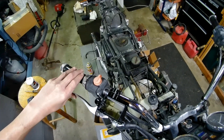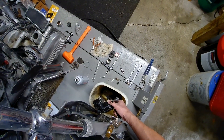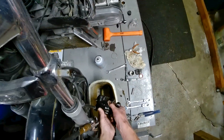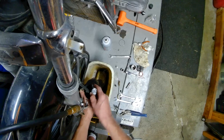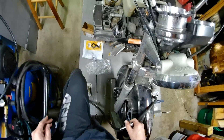Now we're getting a little brake pressure. This one's still stuck though - I can tell she's stuck. The other one seems free. Oh yeah, that piston's seized up - I'm worried this caliper might just be gone.